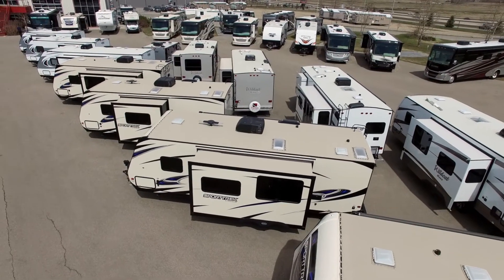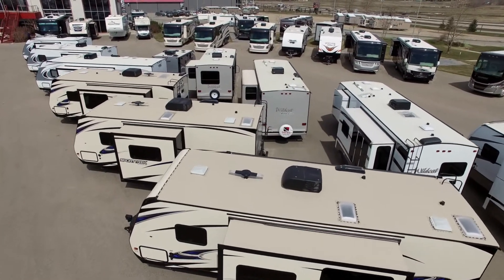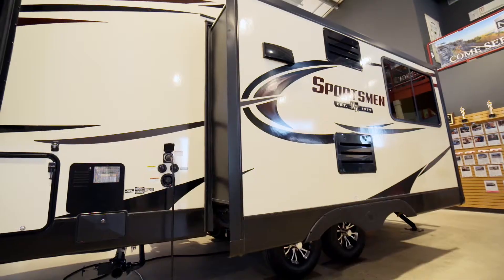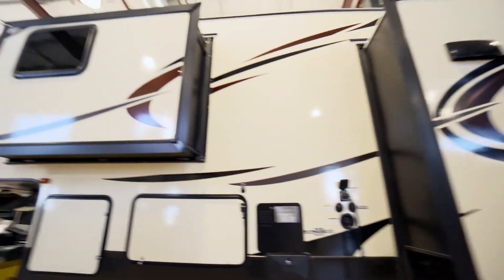Some of the highest priorities we want to look after is anything where there could be water infiltration into the RV, especially after all the snow melts off the roof. We got to make sure that our roof seals are sound. Go up onto the roof and check all the rubber seals around all the vents, hatches, everywhere — make sure it's still sealing to the roof.